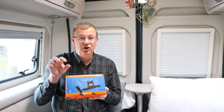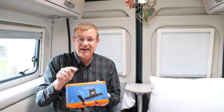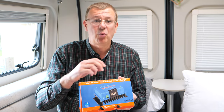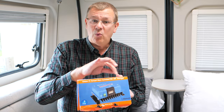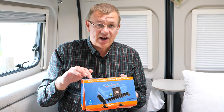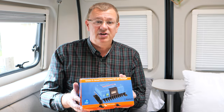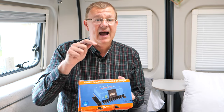First, just a little bit of background: there are two types of Orion DC to DC - there's the isolated and the non-isolated. The non-isolated works by having a common ground between the vehicle battery and the leisure battery. Where you've got that common ground, such as in camper vans, it makes sense to use the non-isolated version. Where you haven't got a common ground - in a boat or motorhome - or if you want more isolation, you can get the isolated version.